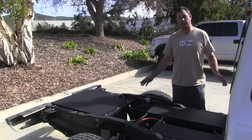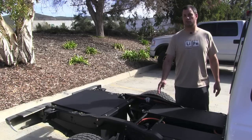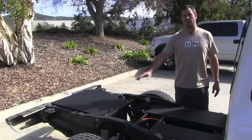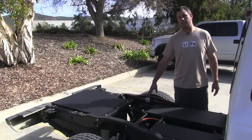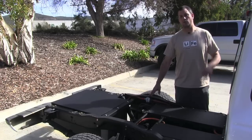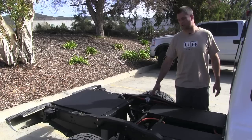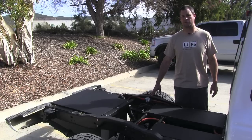We have a real clean simple installation back here. At EV West we always recommend running all of your high voltage traction cables in International Orange for safety reasons, so we have clearly marked visible cables back here. We also have our EV 200 Tyco contactor back here used as a safety disconnect. It's in the middle of the packs, along with our safety disconnects up front. We really like to be redundant with safety — you can almost never have too many disconnection points.